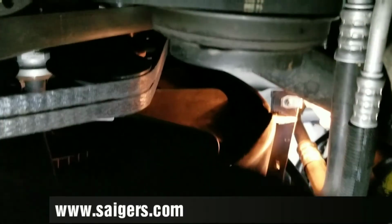And I made sure I brought it from way up top. Sorry, all this in the way. Way up top, there's another set of pulleys to that tensioner. And then down to the crankshaft. And that's the problem. Can't see because it's blinding us. Down to the crankshaft pulley. Following it all the way up. It's all good up top there. Sorry about the darkness. But we're in business. Don't forget to take your 3/8 inch socket wrench off there, or you will have a nasty sound when you start it back up. So, not the easiest thing to do on the Butler, but it's easier than a lot, and it does work.